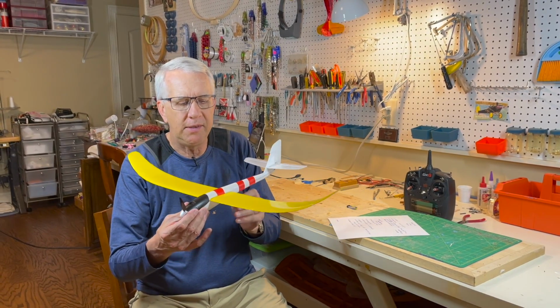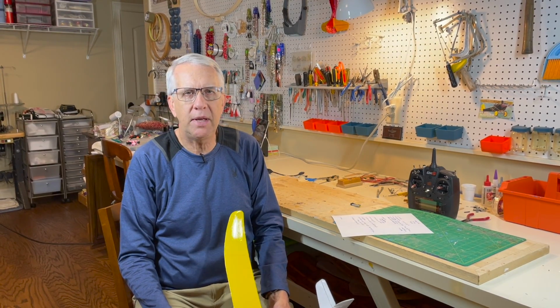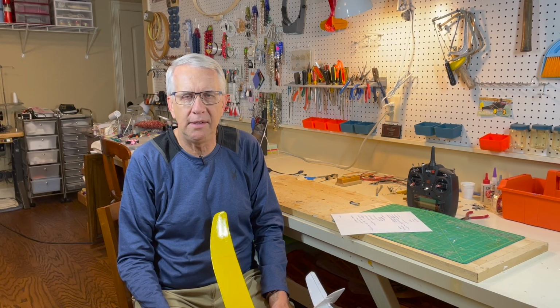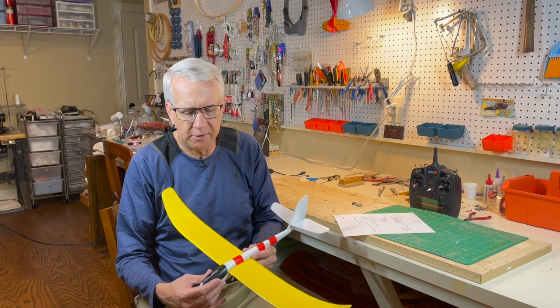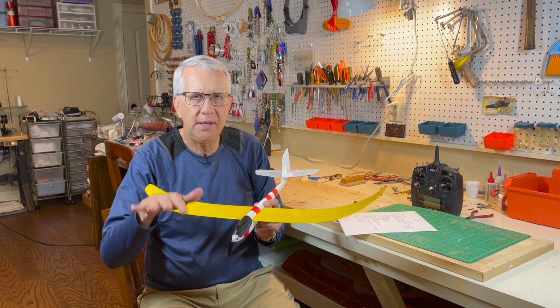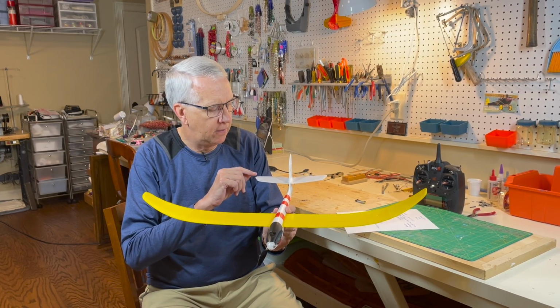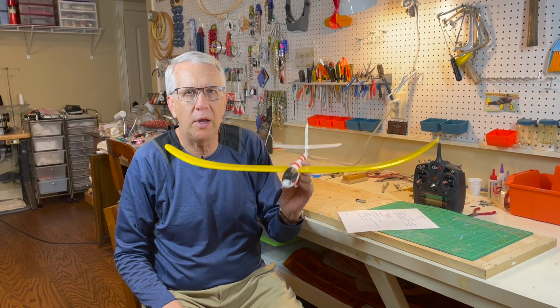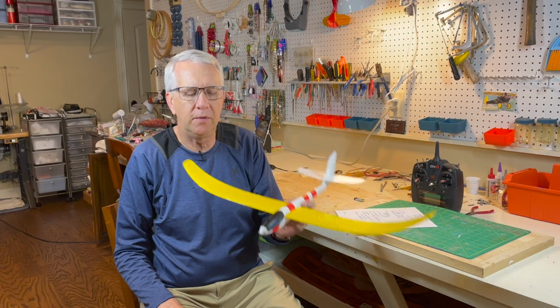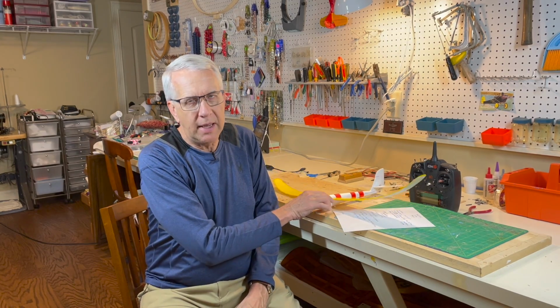And the other bonus is it has AS3X technology built in. AS3X is automatic stabilization in 3 axes. I'll have a card up here, a link in the description. What AS3X is, is some magic built into the electronics where it can sense changes in attitude due to wind and apply instantly very small corrections to the elevator and rudder that have the effect of smoothing out the flight in fairly turbulent air. It sounds a little bit strange, and I wasn't sure about it when I first started studying AS3X, but it honest to God works.